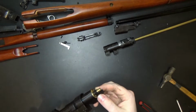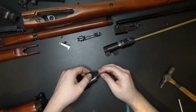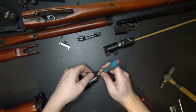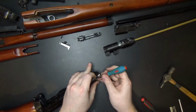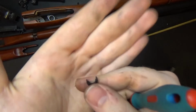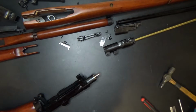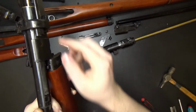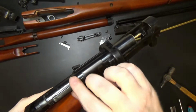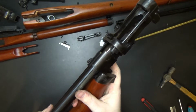With it being a design where there's a tappet plate involved, obviously we're going to have to remove this before we remove the cylinder. Start that off. And these do tend to like to ping off, so be careful. There we go. They've actually done that part in a way where it will hold itself on, so it's not going to fall off. I'm going to slide this tappet plate off here. This little arm sits in the cylinder, which goes backwards and forwards with the cylinder there. Just going to get this piece, pull on it ever so slightly, and then that allows the cylinder to be removed.